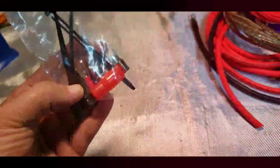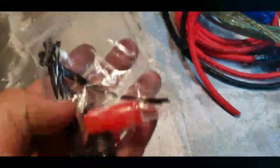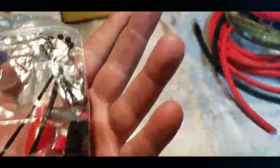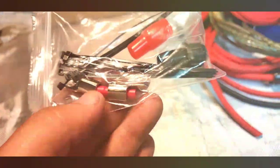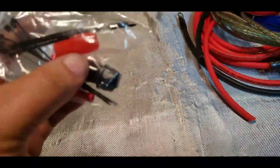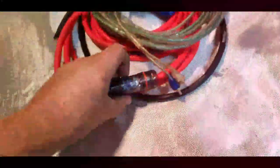You also get this little kit of accessories. If you have one of those more inexpensive amps with the little square screw-down terminals, that's where you'd use these spade terminals — a black and a red with covers to insulate them. There are also a couple of connectors for your remote wire, some zip ties, and a plastic grommet that you'd put into a hole in sheet metal so it doesn't cut your power or ground wire as it runs through.